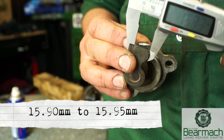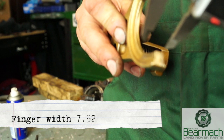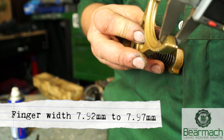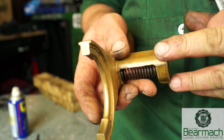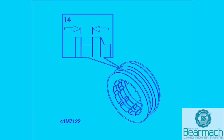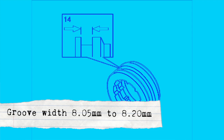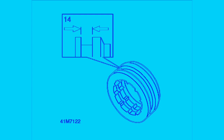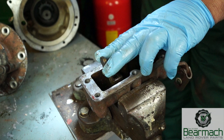While we've got our vernier gauges here we're also going to check the fingers on the selector fork. These have a tolerance shown on screen — measure at this point and on the other side. We're also looking for cracks and excessive wear or any type of damage. If this component is worn or cracked it will need replacing. This one looks in good condition so we'll put it back. The dog clutch selector fork groove has a certain width you'll need to measure — see item 14. Because it's not a synchromesh unit, make sure the teeth on the dog clutch are also in good condition.